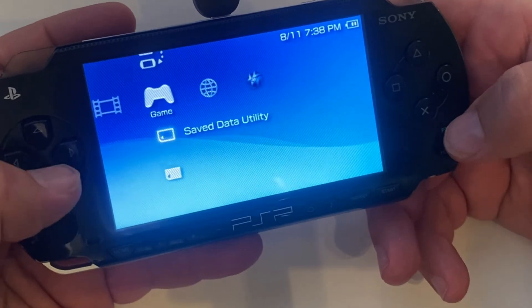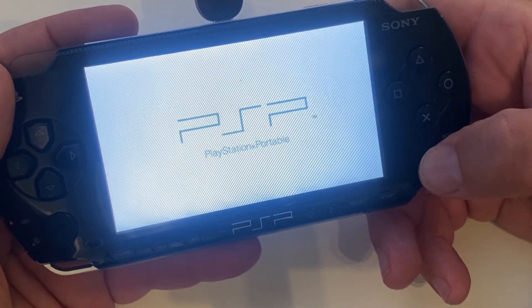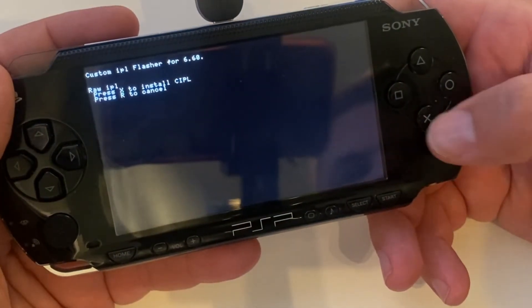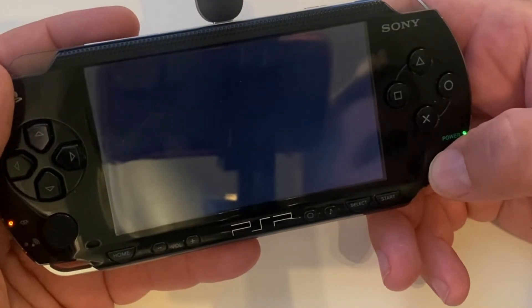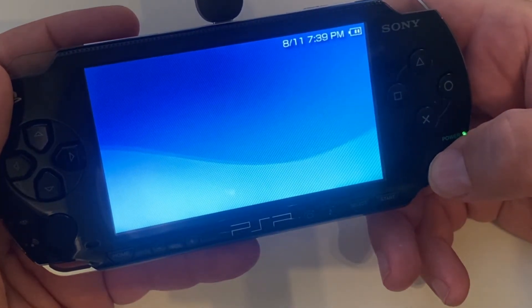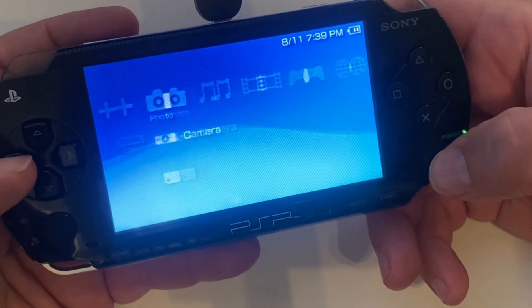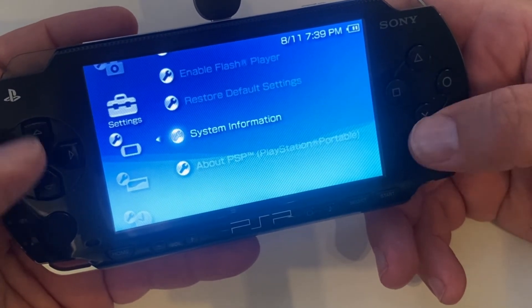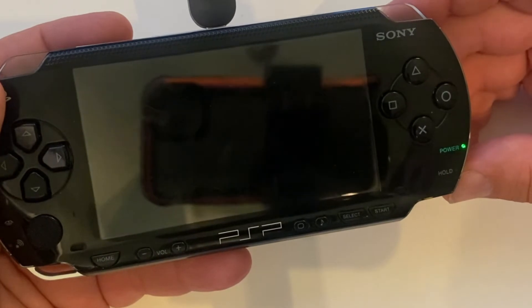I'm going to make it permanent so I don't have to install this every time. We're going to run this CIPL flasher. What this flasher does is it takes what's in the Pro firmware and writes it to the tiny chip in the PSP that allows it to boot, so I don't need to run the CIPL flasher or the update again over and over. It takes no time — it's done and it's flashed. We'll go over to system settings to verify and it's still got Pro-C on there, so we are okay.